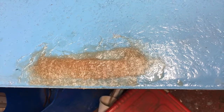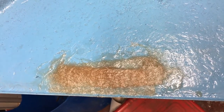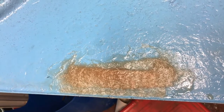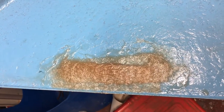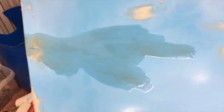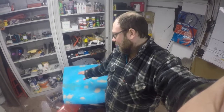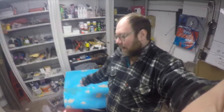Finally added that patch underneath the cracked section on top — that's about three layers in total on there, so I think that's going to do the job nicely. I'm also going to put a bit of resin only on the top side, just so it seeps down into that crack to help reinforce it a bit further. I've taken the resin right to the end of all the spider webbing in the cracks — my thinking being that if I take the stuff all the way up there, those cracks are less likely to start up again later. Bit of an experiment, but hopefully it'll work. Fiberglass is all dry now and the bonnet is feeling much stronger in that area, so I'm happy with that. Time to sand it all back.